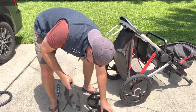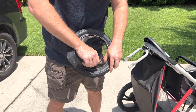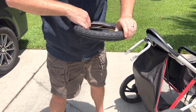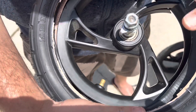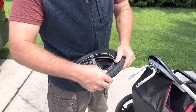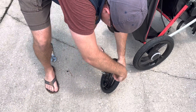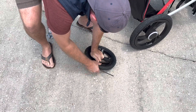Basically, what you want to do is put this into your tire. There are a couple of ways to do this, but this is how I find it works best. Try not to let it be folded over or wrinkled in any way, and seat this into your tire so it's nice and smooth. Make sure it's the right size. Then you're going to want the valve to go into the hole here, and we're going to seat one side at a time. You just want to make sure that that liner stays inside there. We can get most of it by hand, but if you get to where you have trouble, you can grab that screwdriver and just use it to pop it over the seal until we're all seated.